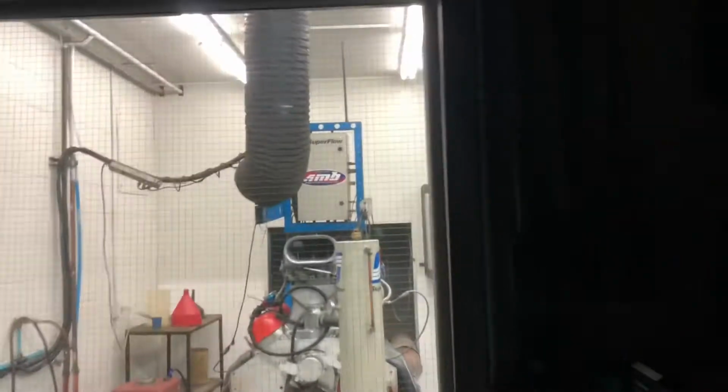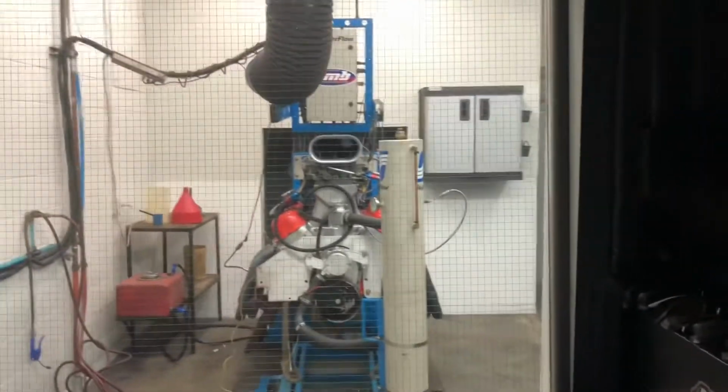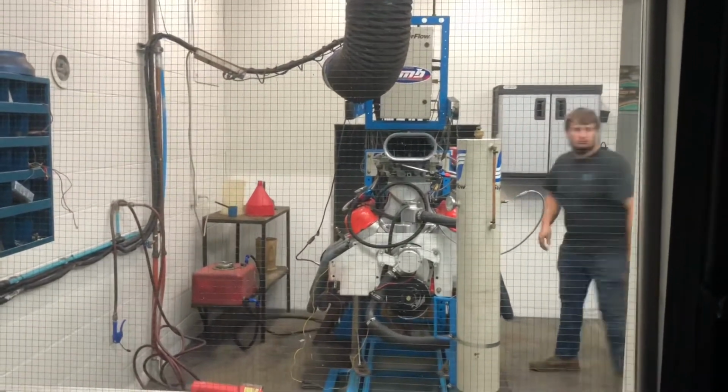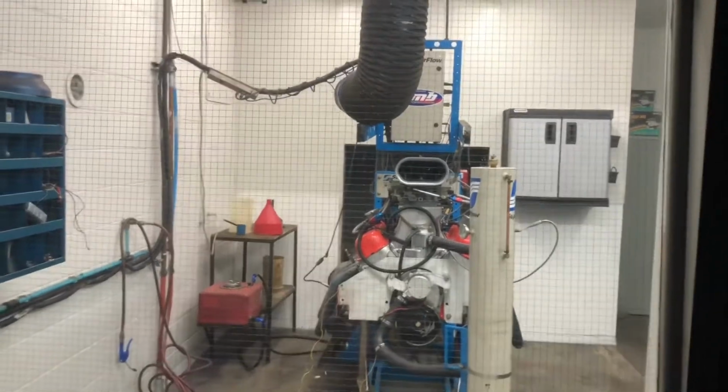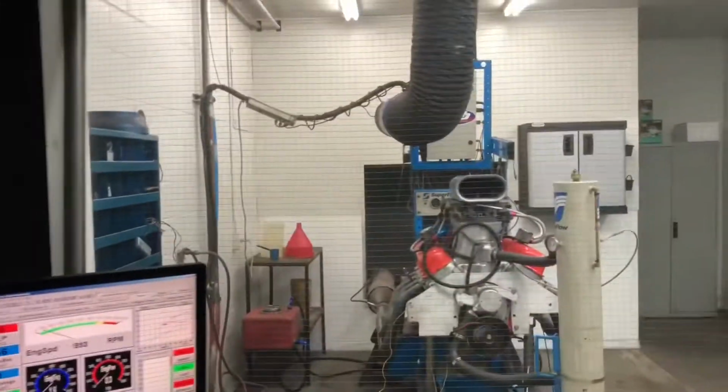All right. Just, like I say, we don't need to go crazy. I'm going to go put the chip back in it just in case, to see how bad that screws things up with that scoop on it. If it does really screw it up, we can make a bigger one. We have to have a scoop. We have no choice because it does draw the gas out of the carburetor.